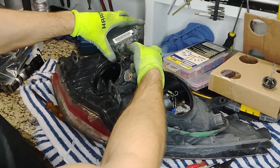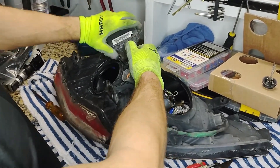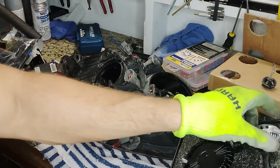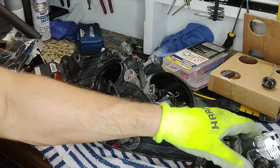That's how you get the ballast out — it's too big to come from this way, so you have to unhook it from here to pull it out. It's hard to get off, but you do squeeze and pull it. With that free, we are now going to work in our LEDs.